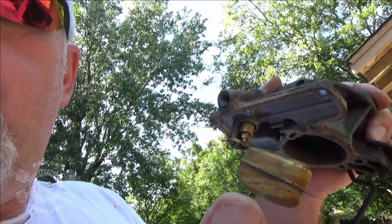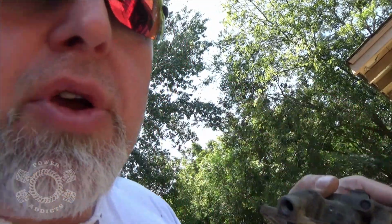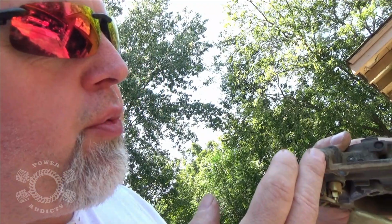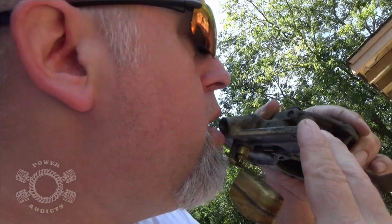We got fuel flow, okay? Then you push this up. I know some of y'all are going, gross, he's got his mouth on it, it's dirty. Well, I've been doing it since before I was legal to drive, and it ain't killed me yet. And you can feel as you blow through it. And if you're grossed out, you can put your fuel filter on there and put a piece of fuel line on it as a straw, however you want to do it.